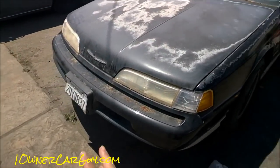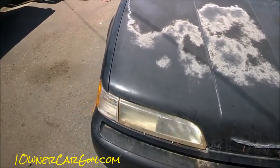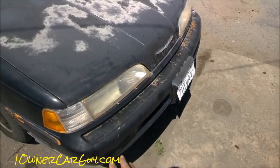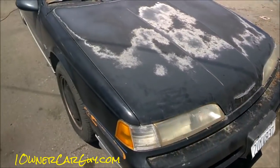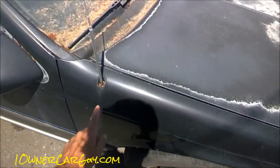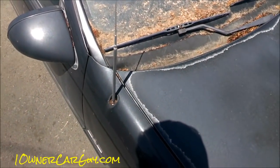Also, for these kind of lights, if you take like a 1500 and then a 2500 or 3000 grit sandpaper and sand the heck out of them, then buff them back out with a high-speed buffer, they'll look absolutely amazing. This whole car is faded, but little things like this are almost perfect — it's a nice car.